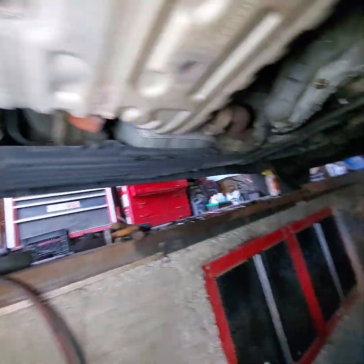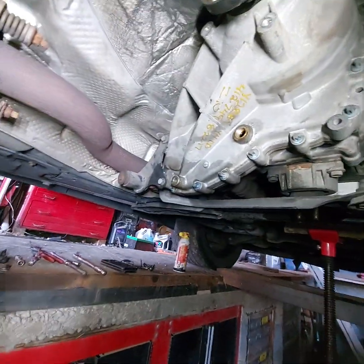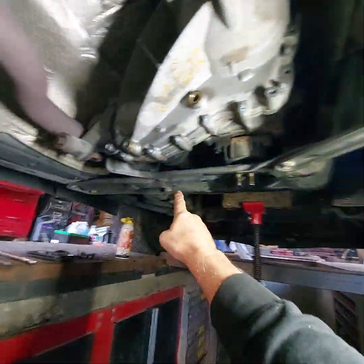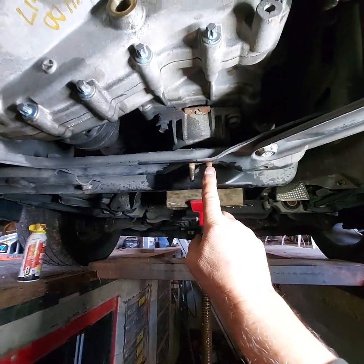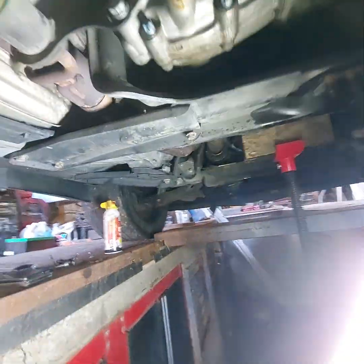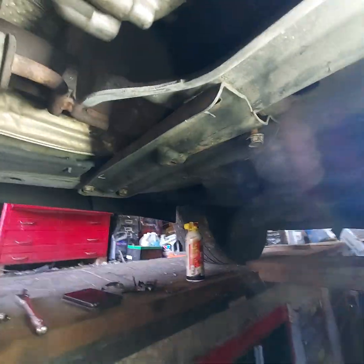and then you can slide your rear drive shaft rearward so you can get the transfer case out. Then I've got a screw jack holding the transmission up, and we'll take this rear cross member all out. I've already got the two 15mm nuts off the bottom of the transfer case transmission mount, and see, we're missing a bolt there. They didn't put that in, but that's a 16mm. These are all 16mm, so that one ain't even tight.